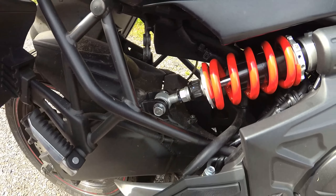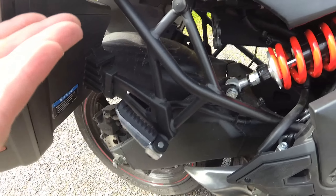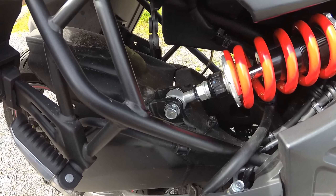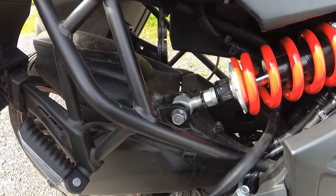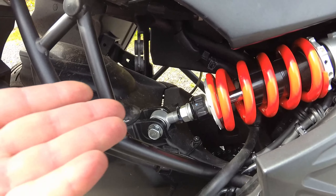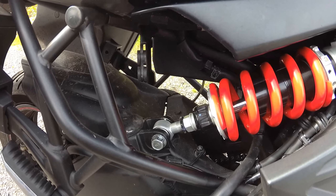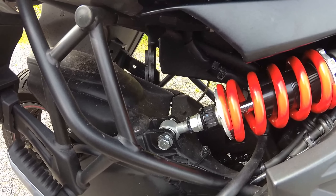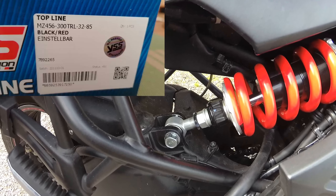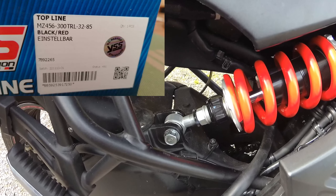5mm on here will bring the swinging arm down about 12mm. So you could reckon the seat would go up 12mm. You could raise or lower the ride height of the bike about 12mm either way — so you've got about 24mm difference in ride height. I tried jacking it up but found it made it just a tiny bit too tall for me. I put it back to the original 300mm. I was a bit worried the spring would be too soft, but it isn't.